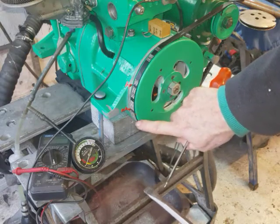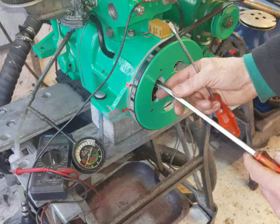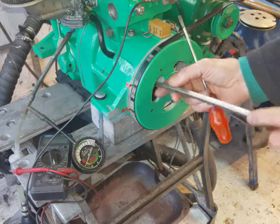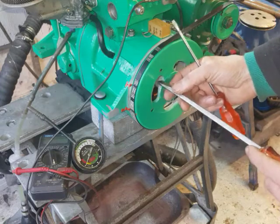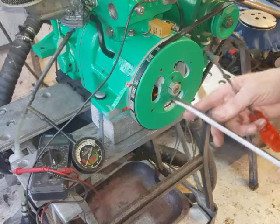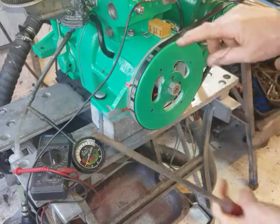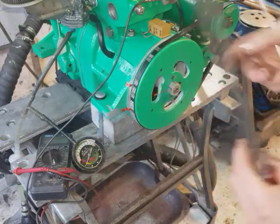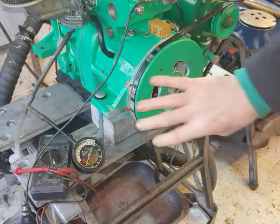If you want to delay the mark and make the flywheel come round a little bit more clockwise before it fires, lever between the screw — you've only undone it one turn — and all three of them. You can lever against the laminations of the coil, not the black material, and it slowly jiggles it round. If it won't go, persevere with all three as it may be a bit stuck, but it should slide around once those three screws are loosened. Then recheck it with the meter.